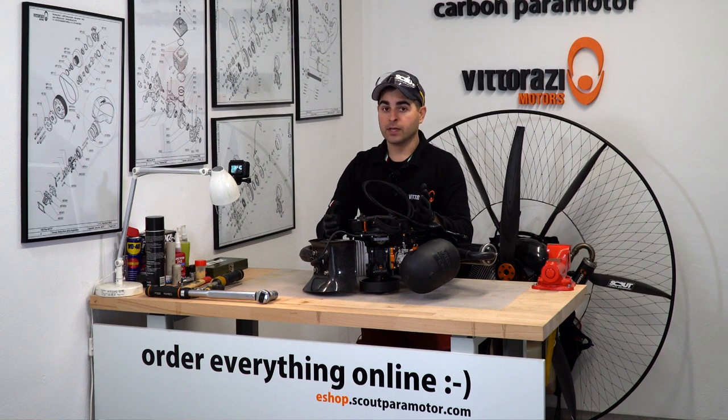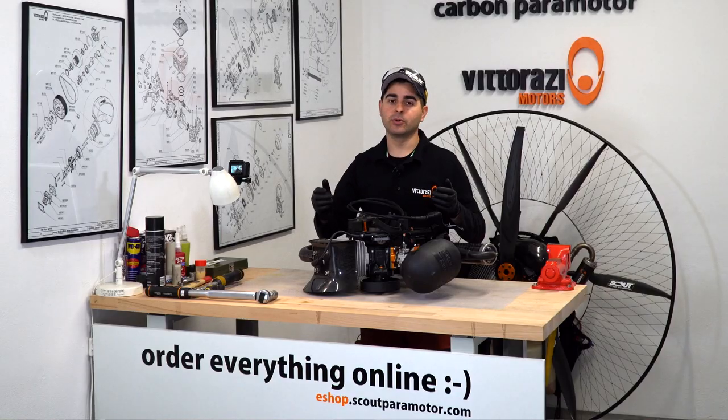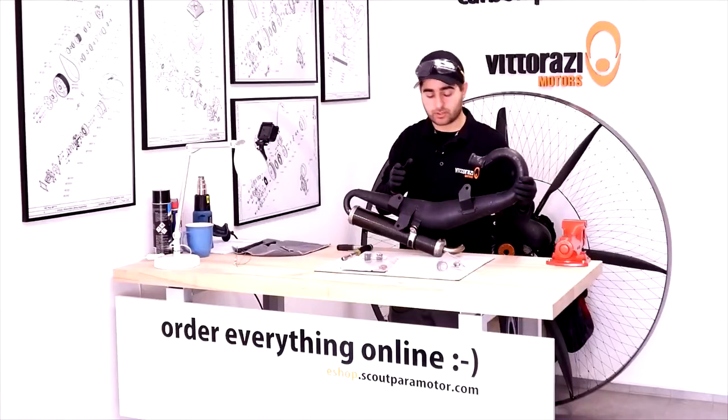Every 200 hours, we need to inspect them, check them, and if worn excessively, we need to change them. I'm talking about the crankshaft bearings. In today's episode, we will go as deep as we can in the engine and open everything to be able to replace those bearings. Let's get into it.